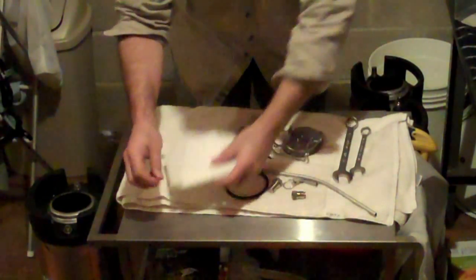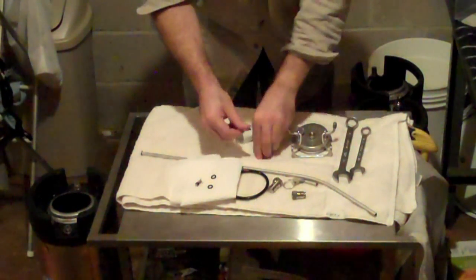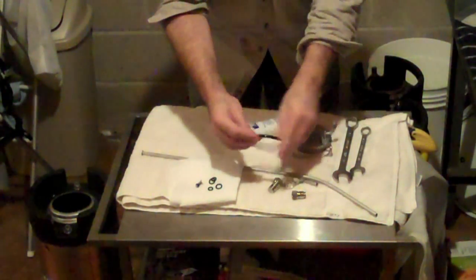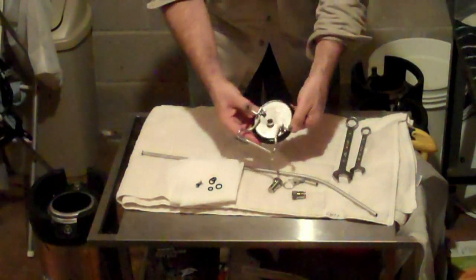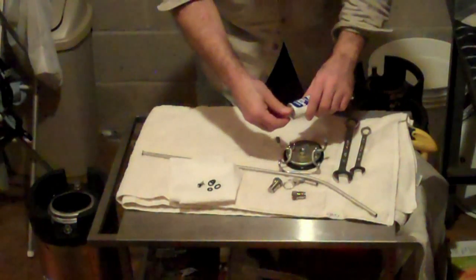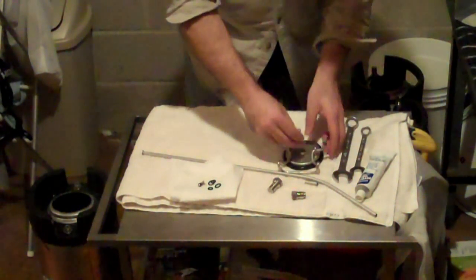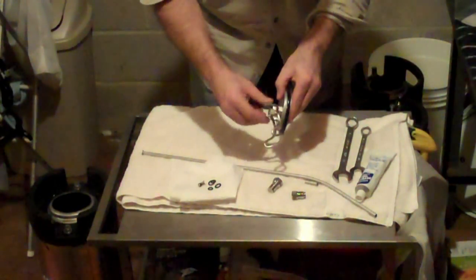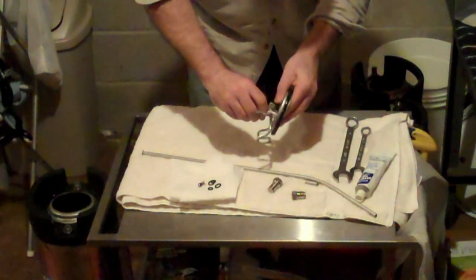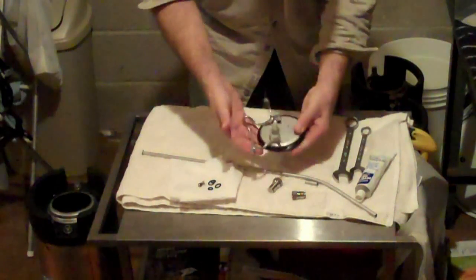I'm going to use my fingers to wipe lubricant on any rubber piece that I'll be reassembling — the O-rings, the poppets, pretty much anything with a rubber sealing surface. It doesn't take much, just a little bit, kind of squishing it around. Now we'll put the O-ring back on the lid and that slides right into place. Then remember to put a little lubricant on the O-ring for the pressure release valve, and install the pressure release valve. Be careful not to cross-thread it — they're only plastic threads. You can see I had a little bit of an issue getting it in straight. There we go — now it's in nice and tight and it's done.